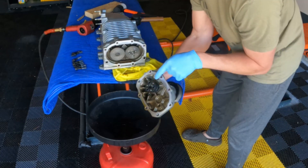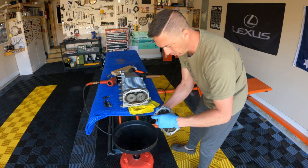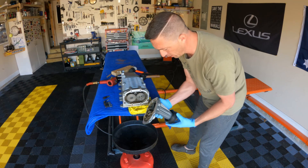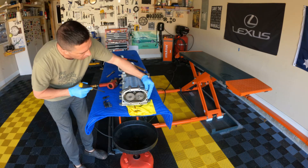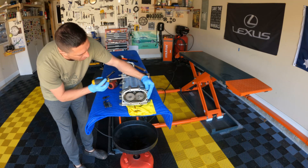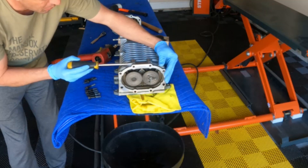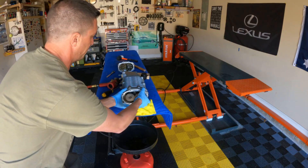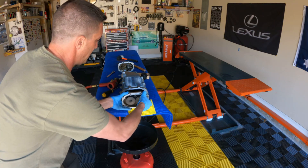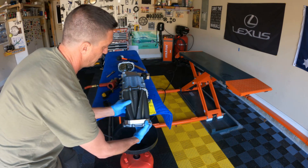This is your coupler right here. A lot of times you can replace those couplers with harder plastic, but this one looks pretty good. A lot of people replace them because you get some play in there. Take a wood block and bang on the top part — it'll start to separate — and then very carefully take a flathead with barely any pressure and the whole rotor assembly is going to pull out of the case.